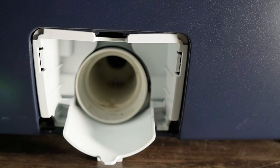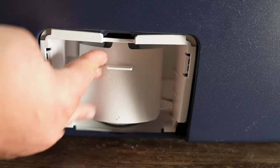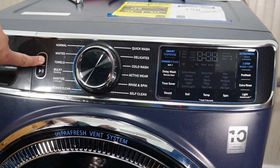I didn't record it when we first bought the washing machine, but that was the exact problem this washer had. I paid $100 to buy this $1,300 GE washer just because there's junk in the pump housing. We had it fixed actually in about 5 minutes. Make sure that the housing and filter are totally cleansed and cleaned before reinserting the filter and putting the plate back into place. Try the washer now that it's cleaned out and see if this solved your issue.